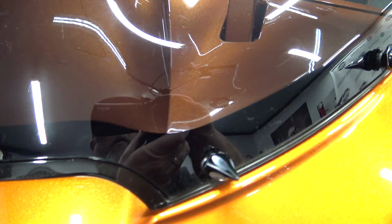So quickly, we're going to go over here and install them on the Road Glide and then on the Street Glide, and it'll give you a chance to see what they look like actually on the bike. So I'll get this up in the camera so you can see it. This is the contrast cut windscreen bolt. Like I said, it does have the nut down at the bottom. It's going to be a 14 millimeter. It will come with a rubber washer on the backside to protect your windscreen as well.